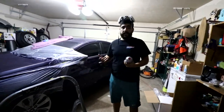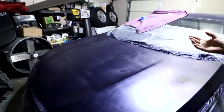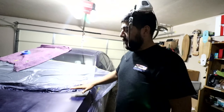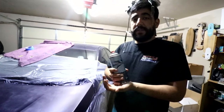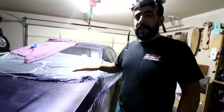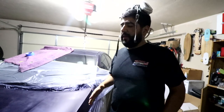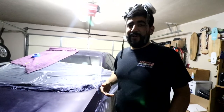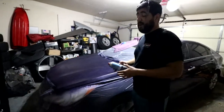Taking a look — we did a couple of coats with our Automotive Touch-Up. Not the best looking job, but we're not going for perfection. We're really just trying to make sure the clear isn't falling off the vehicle. Speaking of clear, we actually have a can right here. I preheated this in some water so that it lays on nice and even. My goal is to try to put enough clear on here that it looks like the factory original paint — nothing extraordinary, but a big improvement over what was on there before.